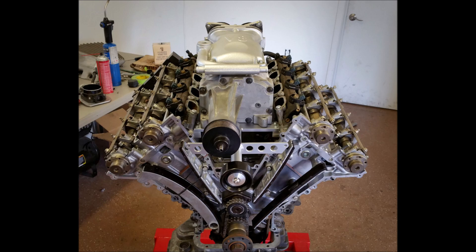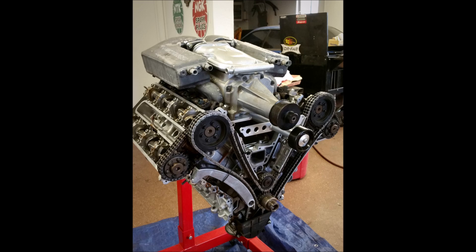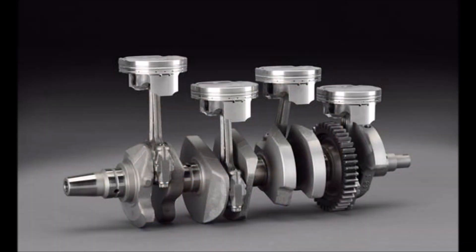To achieve this in the dual overhead cam V8, we must flip one bank's set of cams 180 degrees — or 360 crank degrees. That way, the paired cylinders, one on each bank, have their top dead center compression stroke and thus the power stroke at the same time. There is also another phenomenon that occurs: it disrupts the V8's ability to have a power stroke every 90 degrees of crank rotation, instead making the V8 act like it has two cross-plane four-cylinder engines attached to each other.